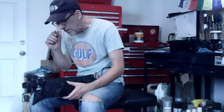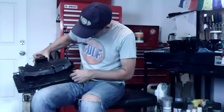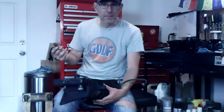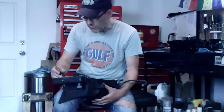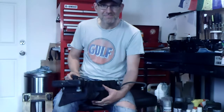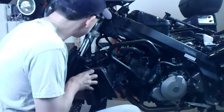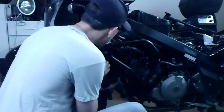I'm spending just a little bit of time, maybe 10 minutes, with my little screwdriver going up and down this radiator on both sides, although it's usually the front where you have the most damage because you get rocks there. And just straightening out these fins. I live in Southern California. We're going to see some temperatures that are over 100 degrees, and I'll be in rush hour traffic, going slow. I want to have the most efficient cooling machine I can. So this doesn't take too long, and I want to own this bike for a long time. Just a few minutes. In you go with the radiator. Nice and easy. I don't want to damage those fins. I just spent so much time cleaning up.